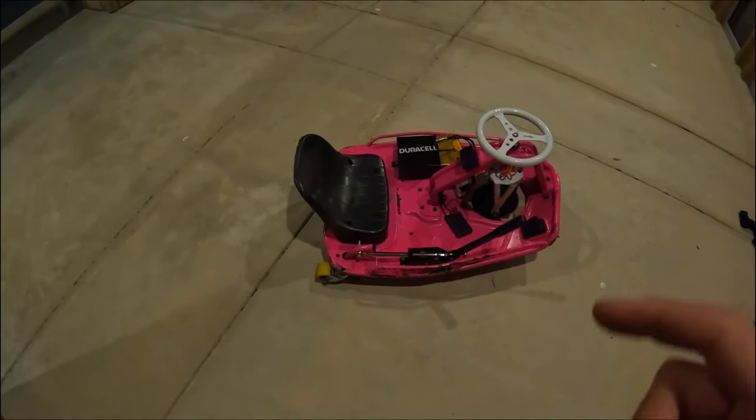But essentially, it comes with a bottom race and a top race. And all you have to do is knock the stock Crazy Cart races out of the mounting locations there. I literally just used a flathead and a hammer to bang them out. And then I used a hammer to hammer the new ones into the cart. It's not really necessary to hammer them in. It was just a tight fit for me. It might be different for you, but I had to do that to get them to seat properly. And then after that, you pretty much just install everything the same way you took it off.